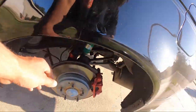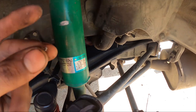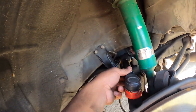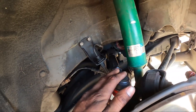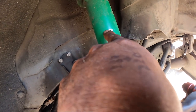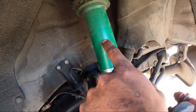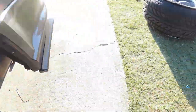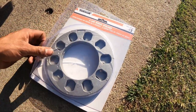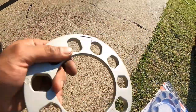Let's go ahead and put this down. Here is the damage. So we maxed the camber out — this gives you a lot of camber. A lot of camber means you're going to be rubbing on stuff. We've rubbed so hard that it will actually slow down the car when we go over a bump. So we'll go ahead and put these — for now these are just O'Reilly's — just until we get hub centric ones from eBay. They're pretty thick though, so I'm hoping they'll clear the fender. Hers is bondoed — whoever had this car last.